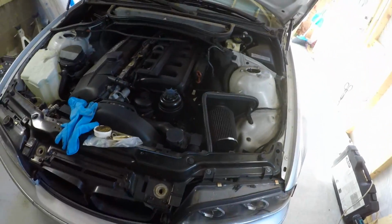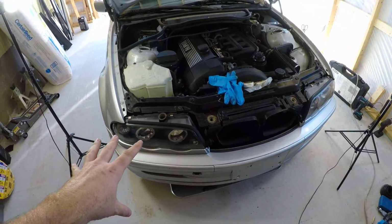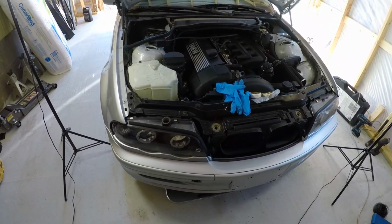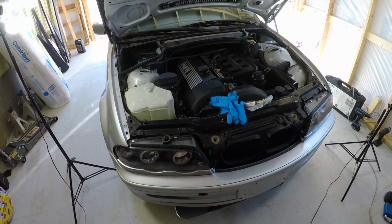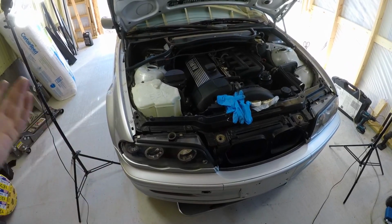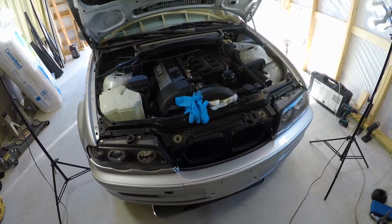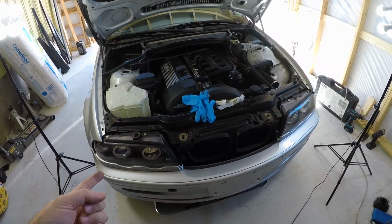They're cheap lights. Now, I don't know, it depends on what your car is. Those halos might flicker too. BMWs are bad about that. The way to stop that, you have to have a resistor, or you have to code the car. You know, I don't know. Since they're not going to come on with the lights, they should not flicker. But you never know what you're going to get, honestly. If you have an E39 that has the halos, and you try to run these on those, they will flicker on those.